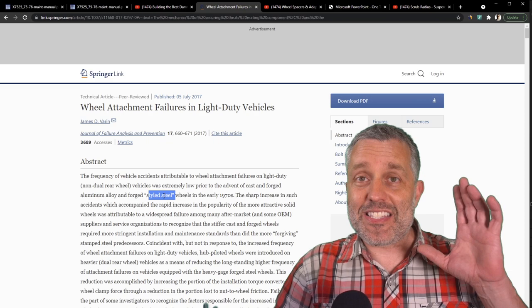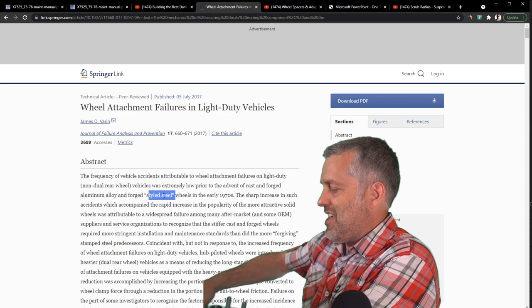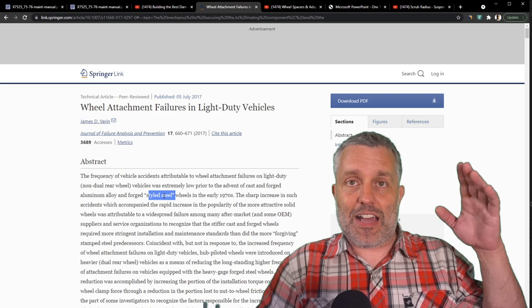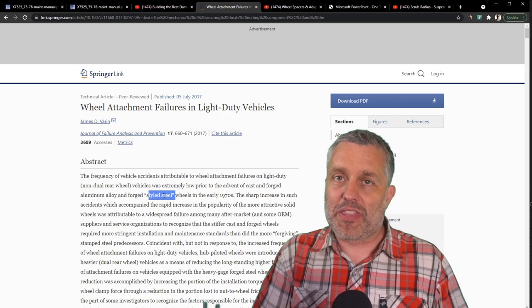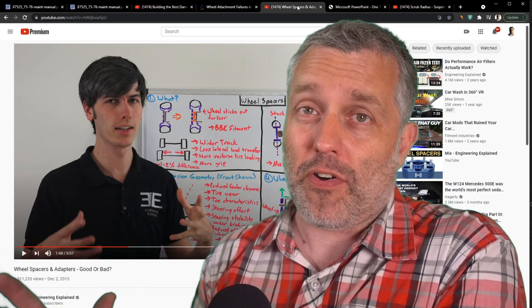Hub-piloted wheels are safer because they're more idiot-proof — which means you all need to go out and check your lug nut tension. Another interesting thing from this article: if your lug studs are fatigued because the lug nuts have been loose — microscopic cracks forming, headed for fatigue failure — torquing them down to the correct specs can actually freeze that fatigue life. Whatever damage has been done, it can just stop it in its tracks. The science still needs more evidence, but there's some evidence that suggests that. I'll put a link to the article in the description.